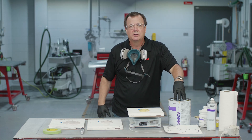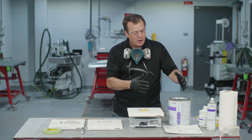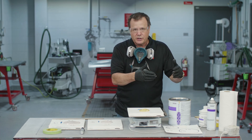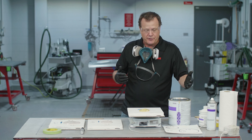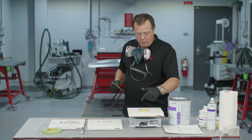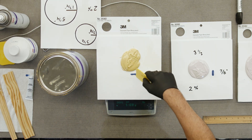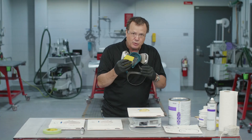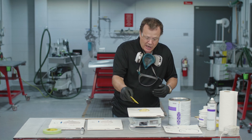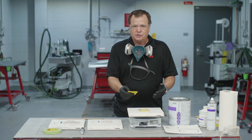Always close the lid on your body filler. Sometimes you'll see guys with sticks sticking out of the lid and the lid open — air gets in, the solvents evaporate, and it changes the viscosity of your filler. Also, you won't get dried-out chunks or dirt in there. The other thing I like to do, especially in the summer, is I don't put my hardener right on my puddle. When it's hot, those chemicals start to kick right away and right where there's direct contact between the two it's already hardening — you might get little chunks. I spread mine out to the side and then mix it together, especially since you may have to walk over to the vehicle.